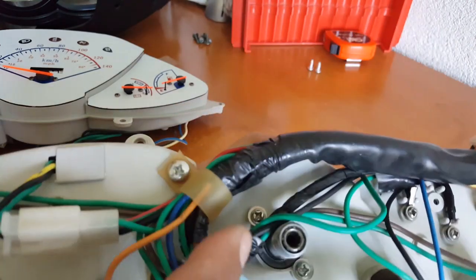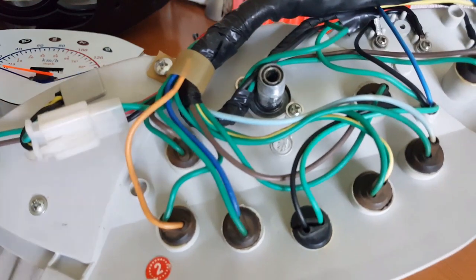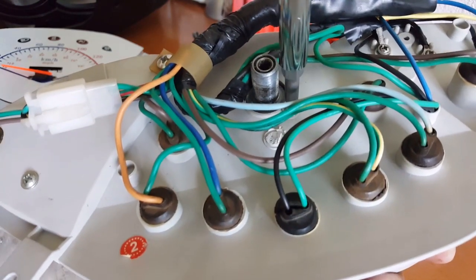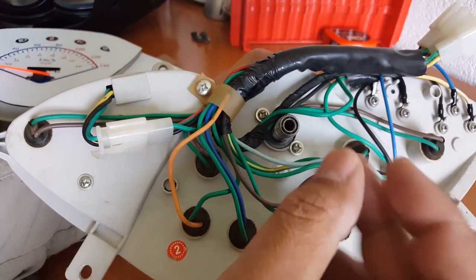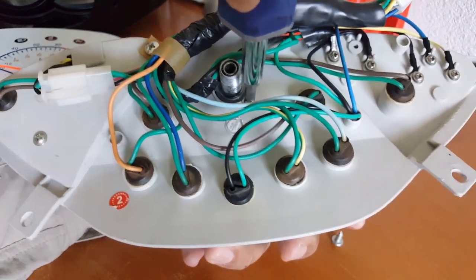It's bringing them in. You want to look at this and see if it actually closes — sometimes it's not closing properly, and then you try screwing the back of it and it starts giving you cross-threading problems. It should go in pretty smoothly without much resistance. Another thing I was thinking about with the carburetor: it's better to use a short flat-head screwdriver instead of a long one. Even though the long one gives you leverage, you can almost over-torque it without knowing — trying to close the air fuel mixture and throttle. Use a smaller screwdriver so you don't accidentally over-tighten.